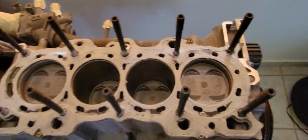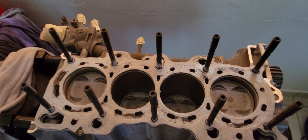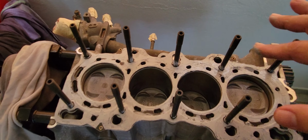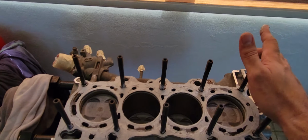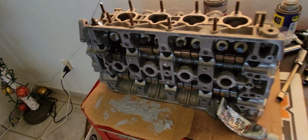Okay, so I just placed a lot of silicone over the gasket. You can just do this on the head, I did it before, and I placed the silicone on the head instead of the gasket, and then drop the head. That would be easier. This is not a job for a perfectionist. There's nothing perfect about this. I'm going now to even it and clean the excess. I'm working against time. The sun is behind this curtain. My location is very hot, and taking the video won't help me, but I wanted to show you. And even the silicone on here, it's drying up. So I'll be back in a moment.